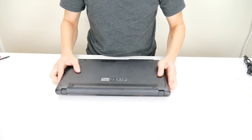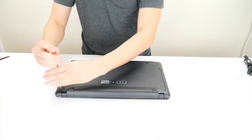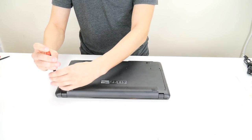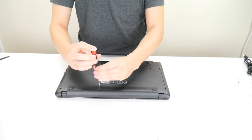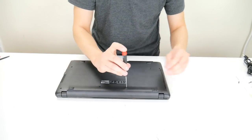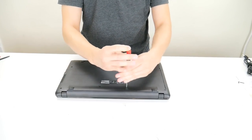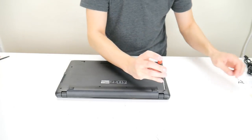So let's get into the computer. You're going to have to open it up — flip it over and take out all the screws you find on your bottom case. It helps if you have a magnetized screwdriver; feel free to just leave it overnight on a magnet. It's a lot easier than flipping your computer over to shake out each screw that comes out.